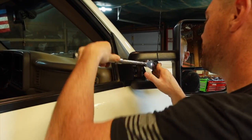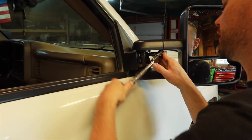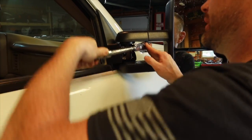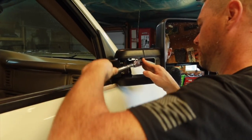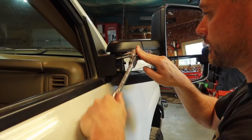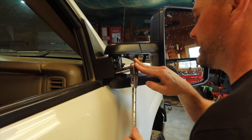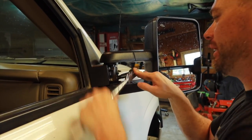The biggest thing you're probably going to get hung up on is the cover that goes back over this. You may end up having to modify it in order for it to fit correctly. If you put three washers in there, I'm 100% sure you're going to have to modify that little cover. I do want to make these somewhat tight because wind is bashing these mirrors — if they come loose you're going to have a bad day.